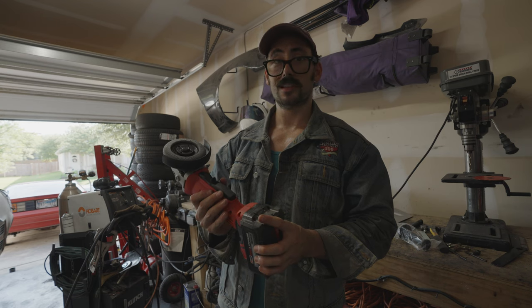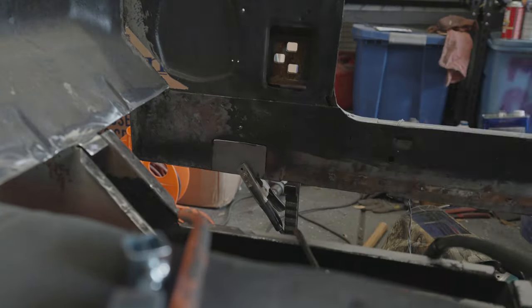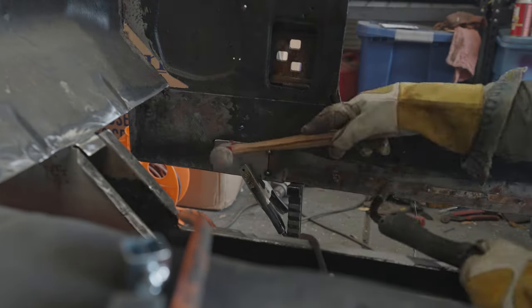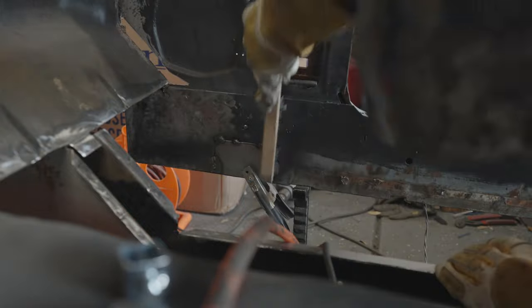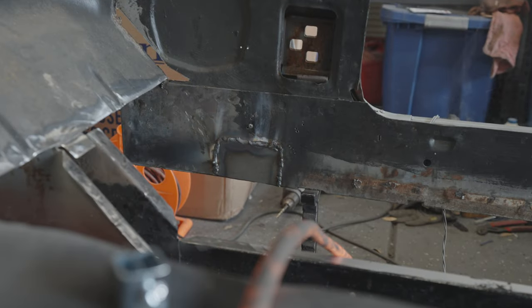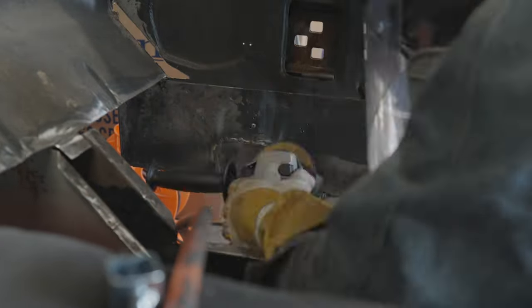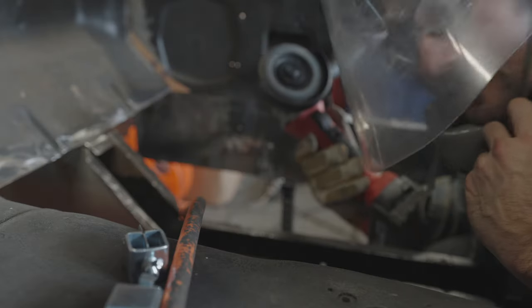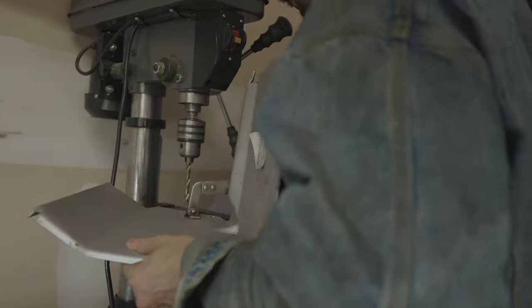The new grinder sounds a little weak; we'll see how long it lasts. One cool thing about this build is I've been able to reuse a lot of steel — this steel is actually from when we redid the frame rails, leftover because I didn't use the whole replacement piece, and it happens to be just the right thickness for these rocker panels. When welding I did a bunch of little spot welds and worked my way around so it wouldn't warp. Big thing: these rocker panels are galvanized steel, so I had to wear a respirator — you do not want to breathe those toxic fumes. Save your lungs.